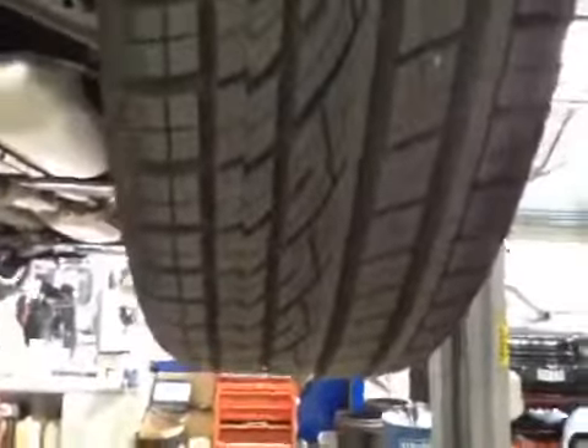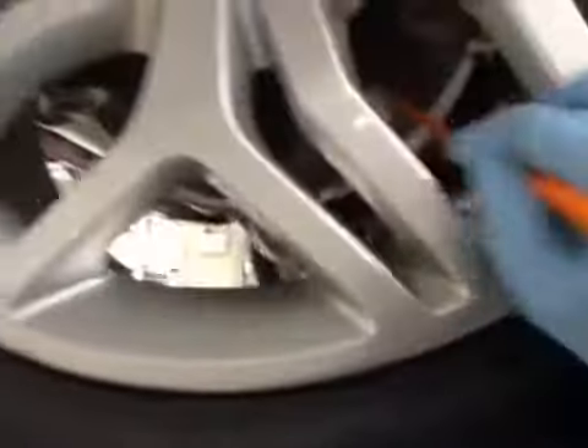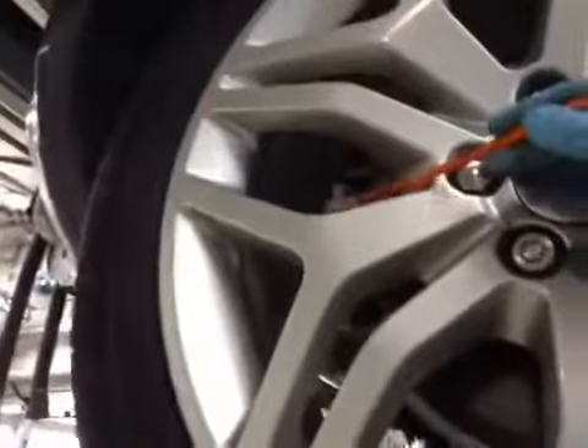This is the driver's rear tyre — tyre is in good condition again. Green on the VHC, no signs of faults or nails or screws inside the tyre. Rear disc is in OK condition. Rear brake pads are roughly on about 9mm. Pads in green, disc in green, tyres in green.